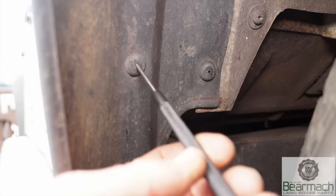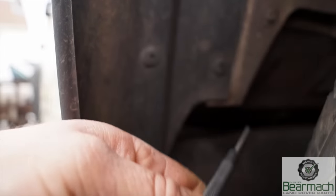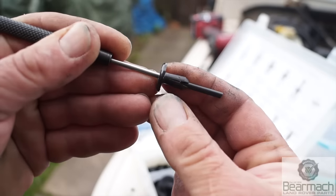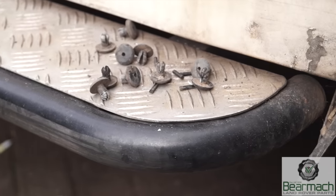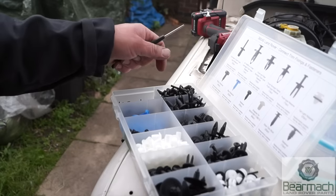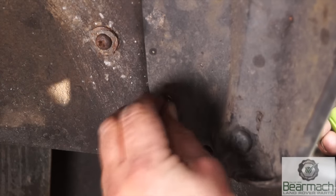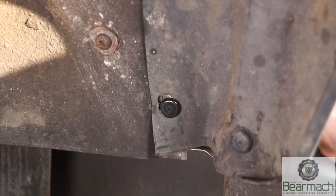For the eyebrow fittings, as I mentioned in the last video, removing this is just a matter of pushing out the plastic fitting. There are two rows of them all the way down. You have to push these out with something which is exactly the right size. A screwdriver will damage them, so if you want to keep them you need to use a pin punch. You can get these from Bearmach. If you buy a set then you're laughing, or if you know a Discovery owner they also have these which hold the plastic trim on underneath the doors. To fit them, just put them in the hole and tap it through - that's all that needs to be done.